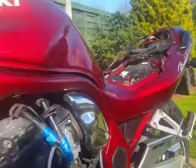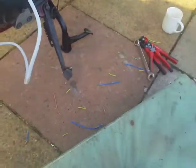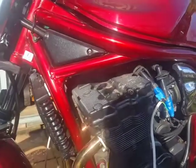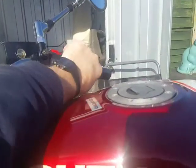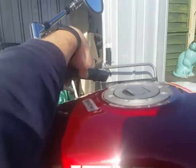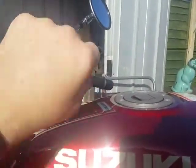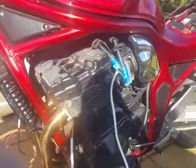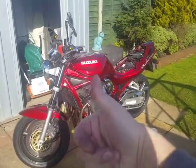I can't turn it round anyway. I'll clear up my mess and be back in a bit to start doing compression tests. I better put it back on the battery charger just to keep it good. The other thing is I've got to remember to hold the throttle wide open when I'm actually doing the compression test — I'll probably tape it open somehow. So another short piece of the story, and I'll be back in the next bit with the compression tester hooked up. Cheers, see you in a bit.